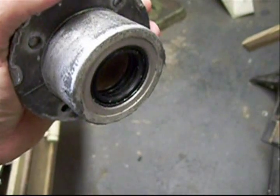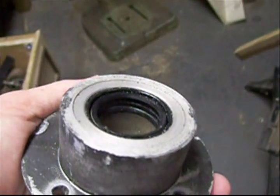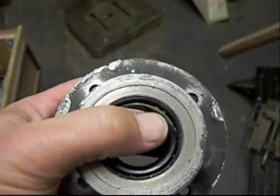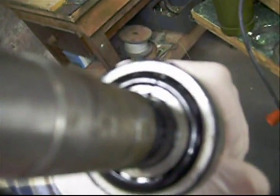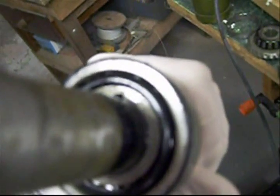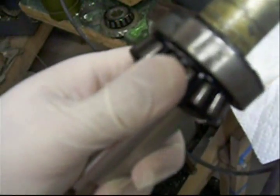Here we've got the fitting on the back for the prop shaft seals. You can see the prop shaft seals here — two black rubber rings with what appears to be a little spiral spring right in here. And on the shaft, the part number is a Koyo 30206, and it might be a JR, JB, or TB. The paint is not really very clear, so we'll have to look and see which one is the right number. You can probably find that online without too much trouble. This bearing is attached and probably needs to be pulled off if it were to be replaced.